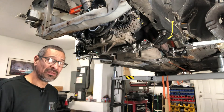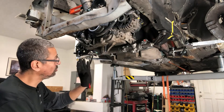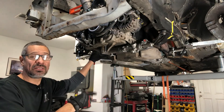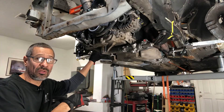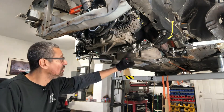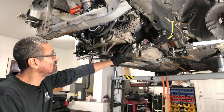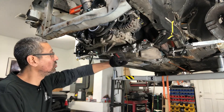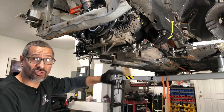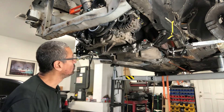It took a lot of going back and forth to make sure measurements were right — a bit difficult working on the floor with limited space underneath. I was able to get the upper mounts in, then took it down and finished welding all the way through, then bent and welded the lower bracket section for the steering rack. She fits nice and snug. I've got about one-eighth of an inch of clearance between the crossmember and the rack — that's pretty good. Header clearance was also something I had to keep mindful of.